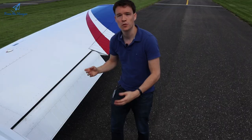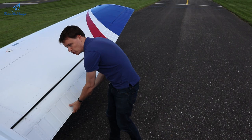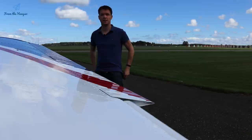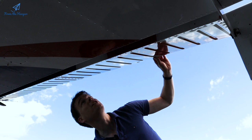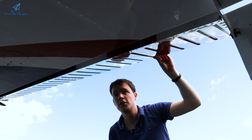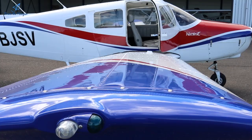We get out for the second lap. Starting at the right wing, I check the flaps — they should move a little but not too much, firmly attached to the controls. Looking at the bottom we can see the attachment point is set up correctly. Next we check the aileron by hand, duck under the wing, check there's nothing obstructing the gap, and look at the connector that holds it to the controls. When you put your fingers in between, always hold with the other hand in case the wind moves it — you don't want to lose a finger.